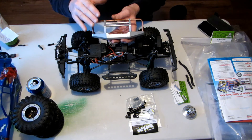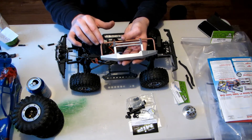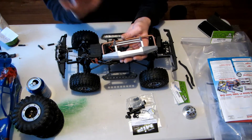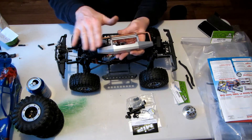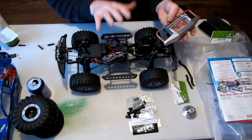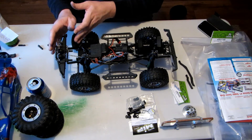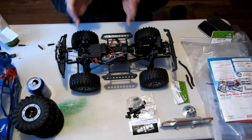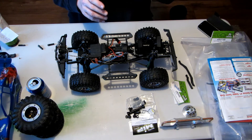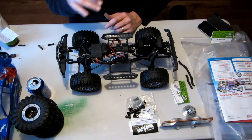There are a couple of little issues with the bumper — I was trying to get it done a little bit faster than I should and these tubes kinked on me. I know why they kinked — I didn't take the time to fill them with something first. That'll get fixed. The plan is to clean up the tubes, paint the bumper, and put it back on eventually. When I did have it on, that was the difference maker — it put it over the limit of what my setup can handle right now, so I went back to the stock plastic bumper for now.